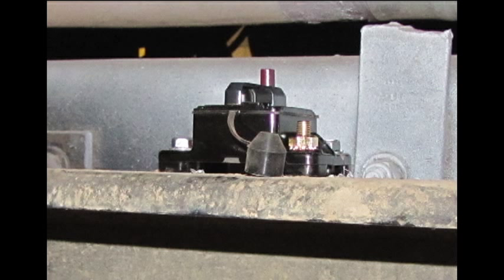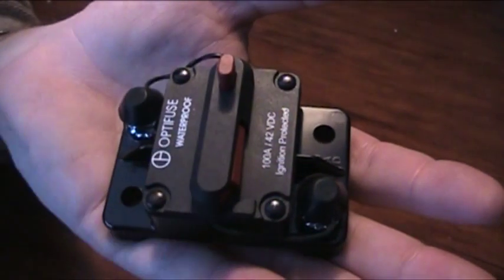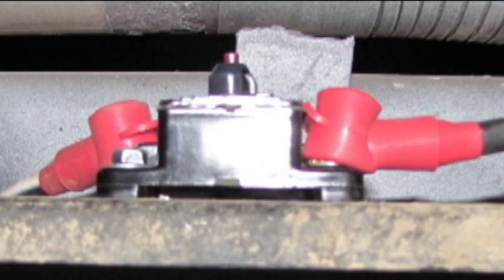First, if your system has an electric over hydraulic pump, check the main circuit breaker. The breaker may already be tripped, in which case it just needs to be reset. If it is not tripped, do so by pushing the button on top and then reset it by moving the flipper mechanism toward the button. The circuit breaker connects the battery cables between the truck's battery and the DC-series electric over hydraulic pump motor.